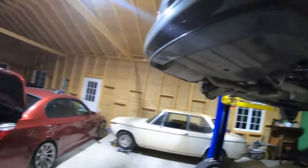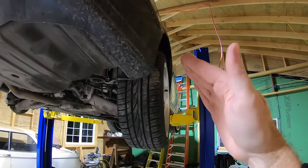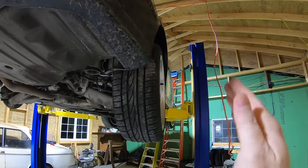If you overdo it, there's less of a chance you'll be able to break it loose later. I've had a few of these cars — especially an X5 — where I couldn't get the cam bolt broken loose; it was all seized up. You can tell when you're behind the X5 that they're tilted in a little bit. We're still tilted in just a hair since the car's up, but hopefully when we let it down it won't be rubbing. Since the top didn't go out and the bottom went in, we should be really good. That's the rear upper control arm and rear ghetto alignment for the E39 — all models: M5, 525, 528, 530, 540, 520, 523. Thanks for watching guys, have a good day — we'll see you soon.